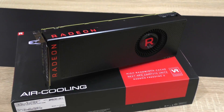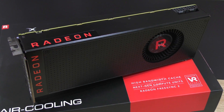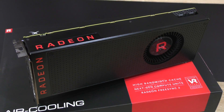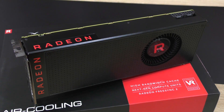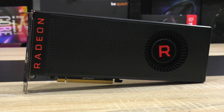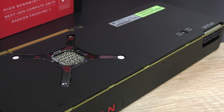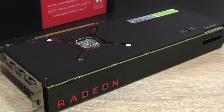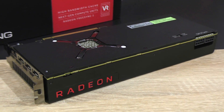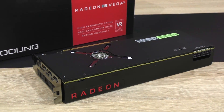In the charts, besides the Vega 56 stock results, I've also included overclocked results achieved with the standard original Vega 56 BIOS. For the GPU clock I couldn't really get any higher than 1647 MHz, be it with the original or Vega 64 BIOS. However, one of the benefits of the Vega 64 BIOS is that I could increase the memory clock — instead of 900 MHz, I could take it up to 1050 MHz.